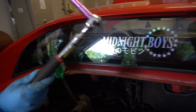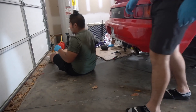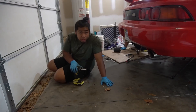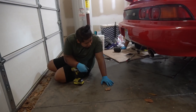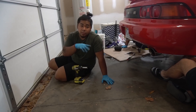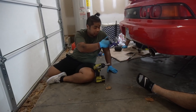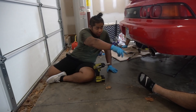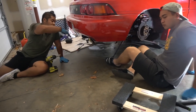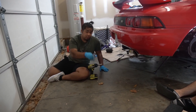Sponsored by Harbor Freight — Harbor Freight Swap. Night boys. We're pretty much on the verge of dropping the motor. We're going to go ahead and drop the crossmember, and then after we get the crossmember down, take off the front motor mount. Then all we have left is both side motor mounts. We're going to use the cherry picker to lower the motor onto the dolly, then tie the cherry picker to the tow hooks, lift the car up, and pretty much yank the motor out to the side. Motor is coming out today — stay tuned.